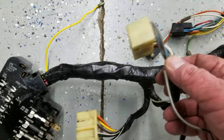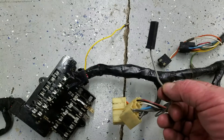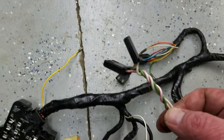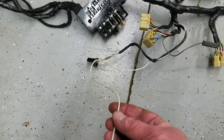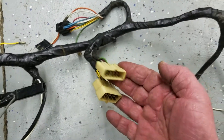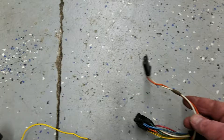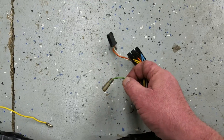This is for the headlight switch — this gray lead goes for some accessory lights, it's gray. This is for the wipers. This lead goes to the door switch for the interior lights. These two clips go to the dash cluster. Here's the parking brake, turn signals, and the horn hook up to the column.